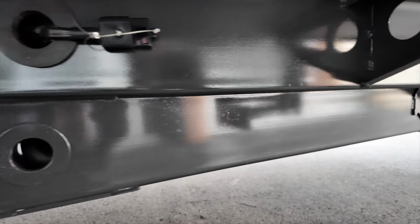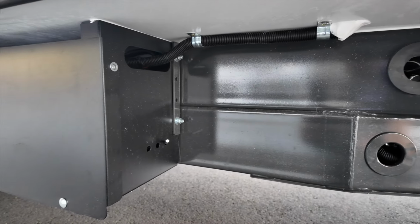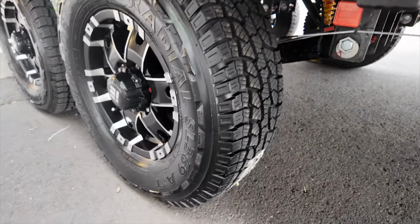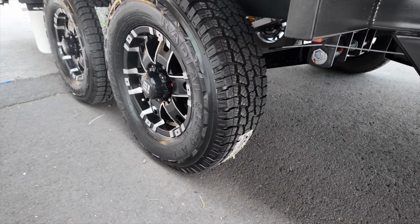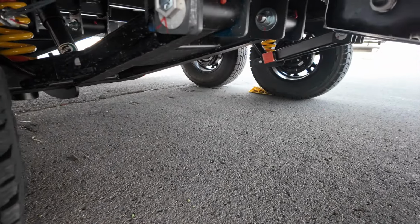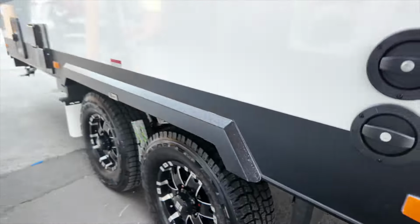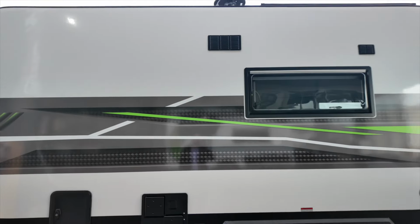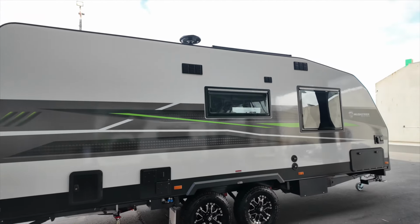Of course, it's built on an Australian made Intelligent Engineering 450 MPa, 3mm steel chassis. It's running now as a standard a 15 inch 235 all terrain wheel and tire, as well as a 10 inch brake Teco Tough Ride suspension. Independent suspension on the Musketeers is a standard, long-awaited, well-desired, well-deserved optional extra, and the guys at Teco are absolutely nailing it day to day.